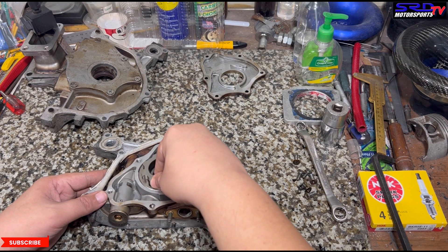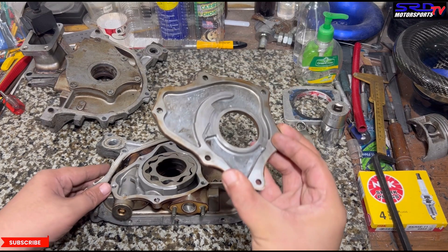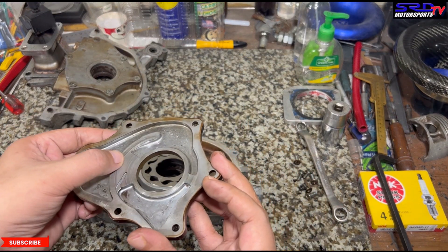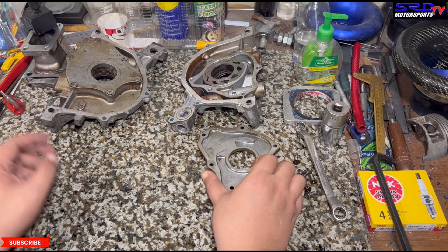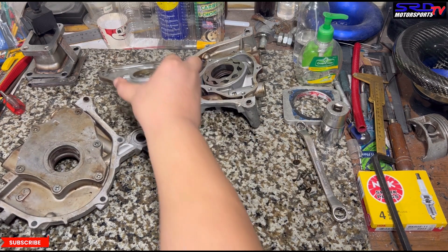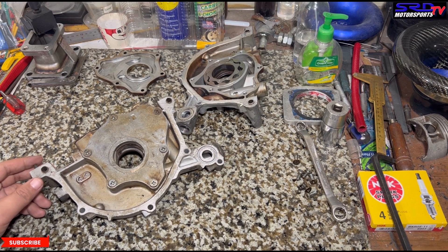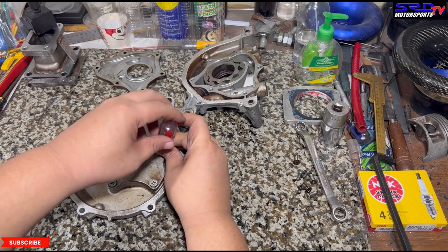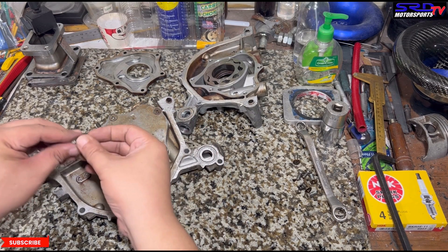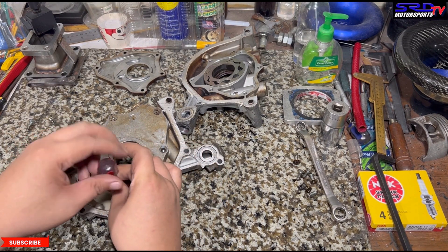Here's the cover of the B20 — you can see the wear. Now here's the B18C oil pump we did earlier — we removed the back cover to show you, we've finished resurfacing it. The oil pressure is not always just about the oil pump — if you have loose bearing clearances like the main bearings and rod bearings, it kills oil pressure. This is why most of our builds run OEM main bearings for street use.